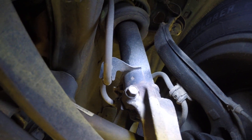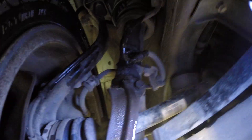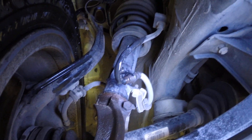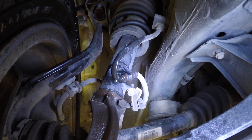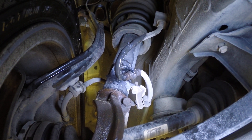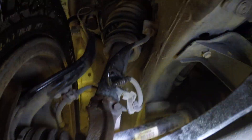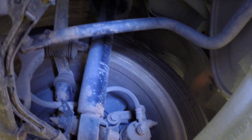But this is an old car — it's a '93 Acura with lots of miles. It might not be a bad idea to go ahead and do all the rubber brake lines. So we're going to replace this one, we're going to replace the one on the other side, and the other rubber brake lines on this vehicle are back here at the rear wheels, so we're going to replace those two as well.